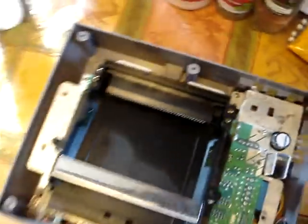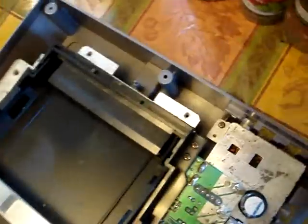And now you have this mechanism. It's held in by four screws — two there, two there. I'm going to take those out because right here is a connector. That is the main problem on these consoles. You can see the actual connectors right there. I need to go in there and bend every one of those things up, and I want to get as much room as I can to use this little tool here that I made.